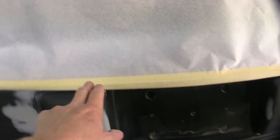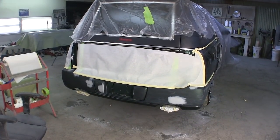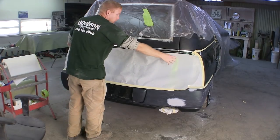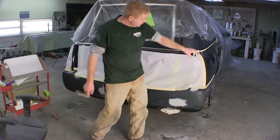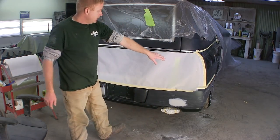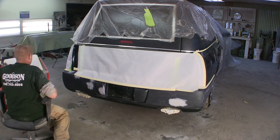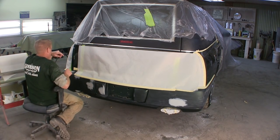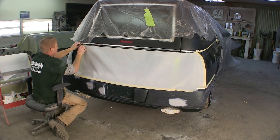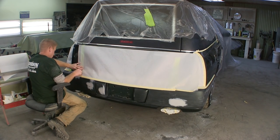So the way I'm going to do this — it's got that plastic applique right here. Let's put you guys up on the stand and just have a short little chat while I mask this up. Basically, I'm going to mask this applique and the door together, and then put a piece of paper that goes from the tail light opening over this and just let it hang, so I don't get overspray on that corner. I'm going to break it down close to the bumper. Hope everybody's doing good — I know I've got some videos up now. I still have internet problems at home, so I'm still having to go somewhere else to upload.